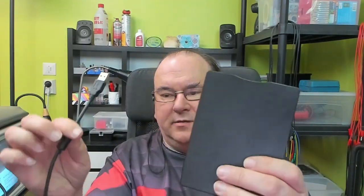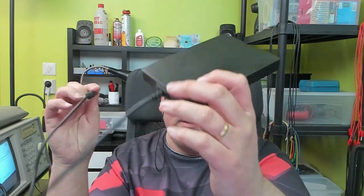The question remains: was I able to create an image from the disk, and was I able to put an image on a disk that worked? Sadly, I must report no. The main reason is — and it's even documented in the comments around this — USB floppy disk drives are not the thing to use and will not work, and will never work. All the information I have starts with the fact that you need a physical floppy disk controller and a physical floppy disk drive.